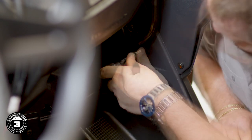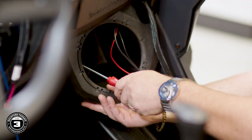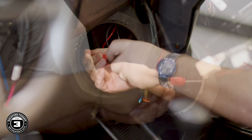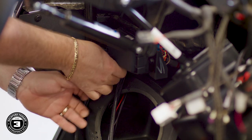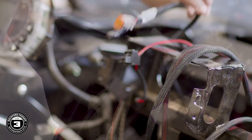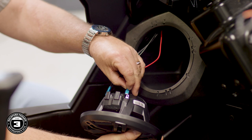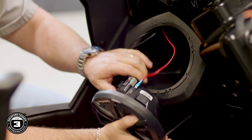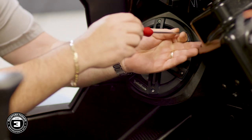Now that you're done with that, you're ready to install the lower speaker pods. Start by replacing the factory bolt with the provided threaded standoff using a half-inch socket. Then use the provided driver and hardware to mount the enclosure to the standoff and the floorboard. Be sure all three mounting locations are tight. Once installed, route your speaker harnesses up to the center area. Now you're ready to install your speakers — connect the speaker by attaching the red wire to the positive spade lug and the black wire to the negative spade lug. Plug in the four-pin Deutsch connector for the Color Optics feature. Position the speaker in the number three hole on the pod and secure it using the included three-millimeter bit and supplied hardware.